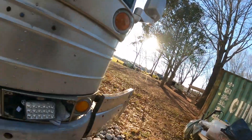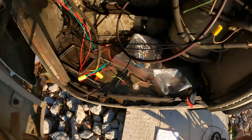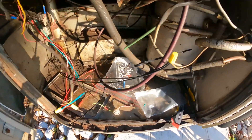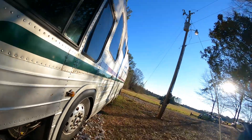What I've done is I've actually hooked the headlight up, as you can see right there — just one of the four is hooked up. Went inside the compartment here and I just temporarily hooked the red to the red, the green to the brown. Red is high beam, green is the low beam, and then the black is the ground. So we're going to see what happens when I turn the headlights on. If I blow everything up, maybe they'll even work. Let's go inside the bus and see what we have.